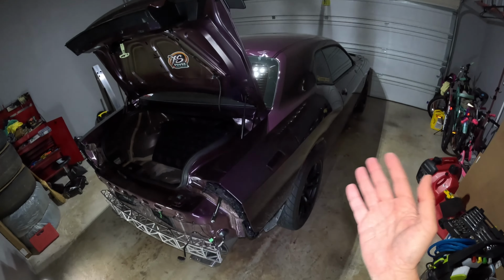So again, a quick tip: I had trouble lining it up because the plastic absorber, which is clipped to the cover, was not going around the bumper support. It kind of went off and that was causing issues. I think on the 2014s and older, the absorber just snaps onto the support, so it's easier. But on these 2015s and up, because that absorber is attached to the bumper cover, you have to make sure that lines up. I didn't do that, so that's why I had trouble on this side. The other side got lined up after I wiggled it a bit, and that's why it fell into place. So reinstalling, not as simple as I thought, because you don't really recognize that part when you're pulling it off. You just pull it off, so.